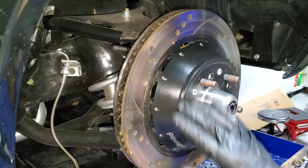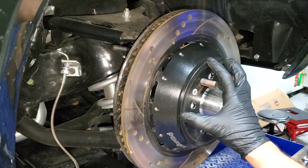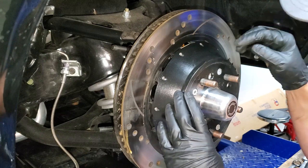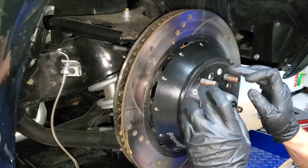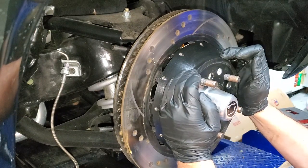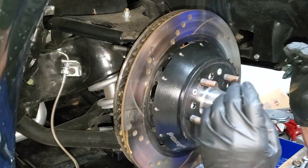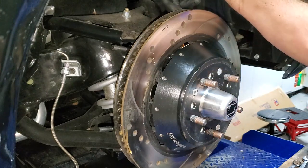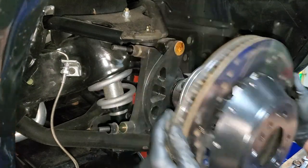All of you should have locking fasteners that keep the disc on the hub. Please, you guys with drums and stock disc, leave a comment and help everyone out. If I recall, there were two lock nuts on the disc. Feel free to break out your Liquid Wrench and let them soak because I'm sure they're rusted on there. Your disc might be rusted on the hub too, so keep that in mind.